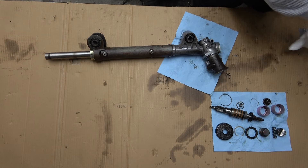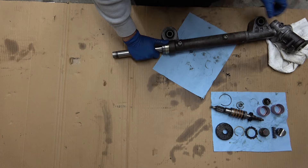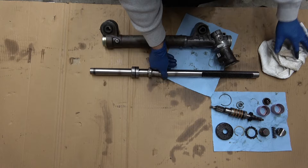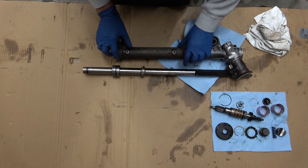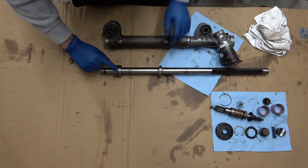Now with that removed, we should be able to pull the rest of the rack out. Pull the rack out of the housing. Here's the seal and the bearing I was talking about — the bearing that slides inside with the rack going back and forth. This is the piston, if you want to call it that. The fluid is on either side in the seal — those two lines were feeding fluid into this side or that side, and depending on which way you're turning, it pushes the rack inside, giving you rack and pinion steering. This seal right here wasn't leaking too bad, and this boot wasn't too wet, but everything is still getting replaced.